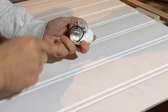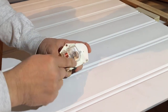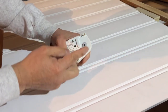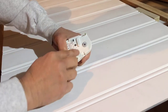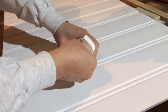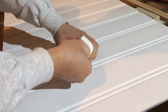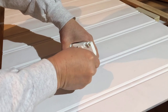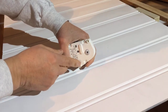It works through a clock gear that rotates the timer. This is what you see on the panel inside the fridge where the temperature adjustment is. You can rotate this with the fridge power on, and you can hear that click — that click basically turns on the heating cycle.